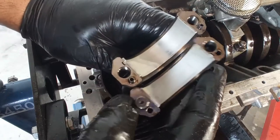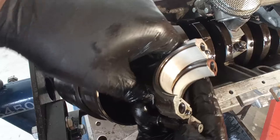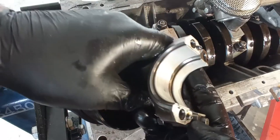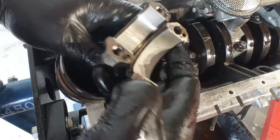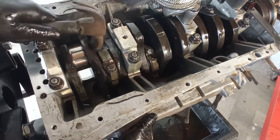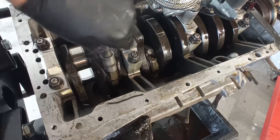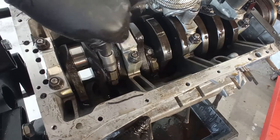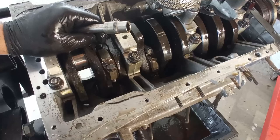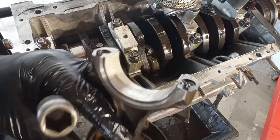This engine, being 0 kilometers, does not have any running time. And as soon as they turn on the engine with the wrong timing, the inner collision of the engine makes the half bearings create those scuffing marks. But here on number 4, that's different. That is not the same problem.